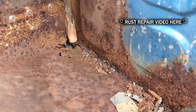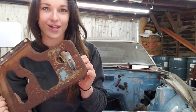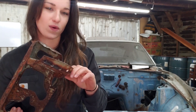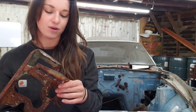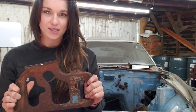There's definitely some rust, but now that the battery tray is out you might be able to repair that a little bit. We got the battery tray out finally — it's still structurally sound. We decided we don't want another welded battery tray, so we definitely want something that bolts through the fender, maybe with a riv nut, so we could recoat this.